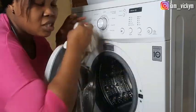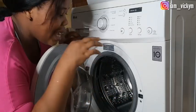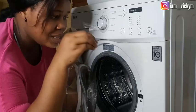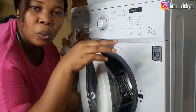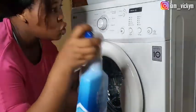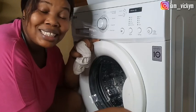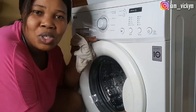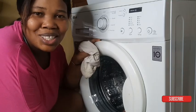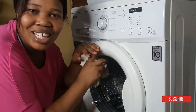This is just how I normally wash my washing machine. First I use the sponge or rag to clean the rubber seal. Then I use baking soda and white vinegar to wash on the highest heat — two separate runs. Then I use the spray cleaning agent to clean the surface, making it sparkling clean. If you'd like to try my method, please leave a comment, give this video a thumbs up, share it with your family and friends, subscribe to my channel, and turn on your notification bell. Thank you very much guys for watching — see you in my next video, bye!